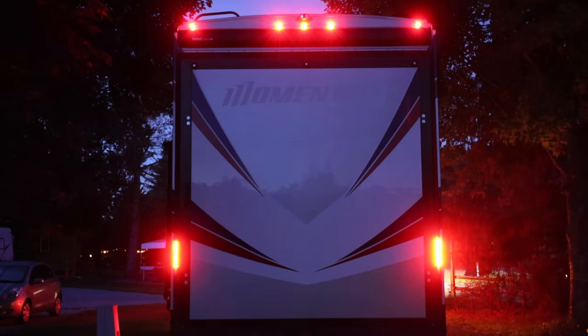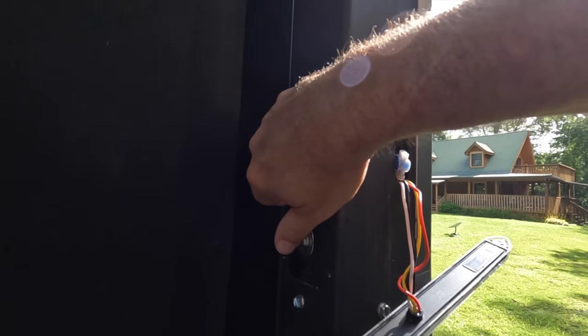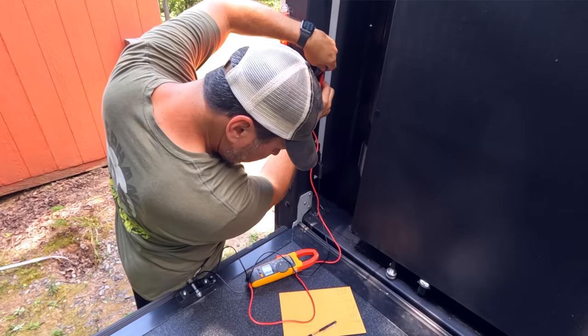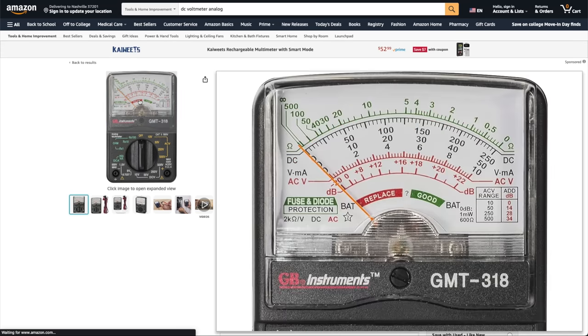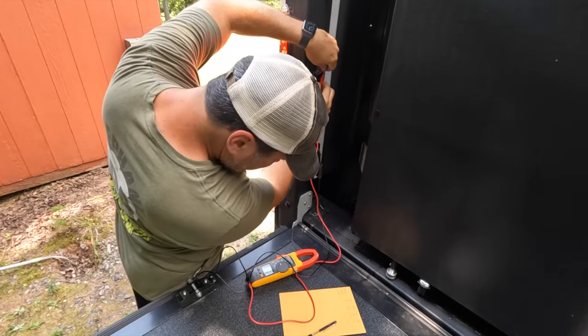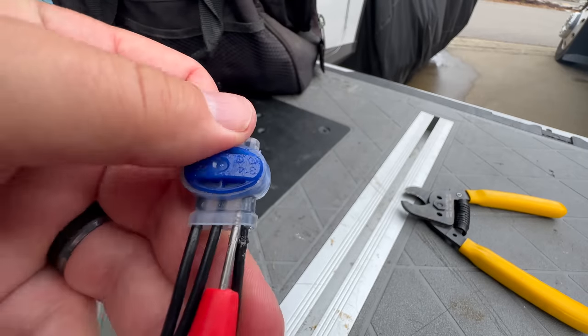When you meter these out, use your tail light wires as a reference. The important thing is to map out each tail light function to a wire, and then you can use that information going forward to wire up the light bar. This color mapping should also be the same on both sides of your RV, so you should only have to do it once. You will need a basic DC voltmeter to take these readings — any meter will do. You don't have to use an expensive one. Even the cheapest, most analog meters will work just fine. We're talking about DC measurements here, so the black lead goes to ground, which should be anywhere on your RV chassis where there's bare metal. I use a little clip adapter and just clipped it right to a bolt on the frame. Then you take the red lead and insert it to get your readings. How you use that probe will be different depending on what kind of crimps you're dealing with.